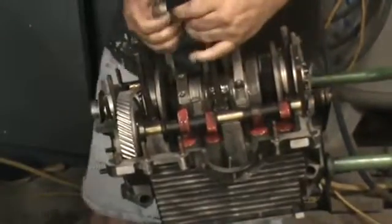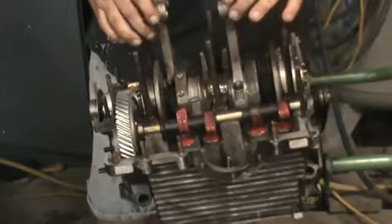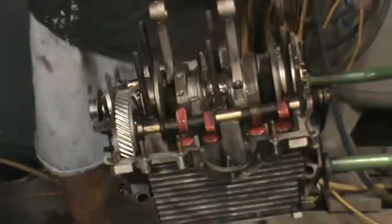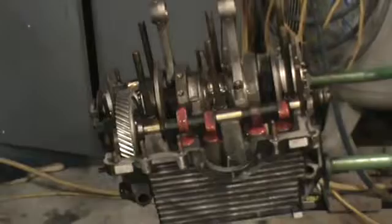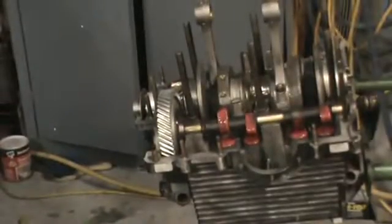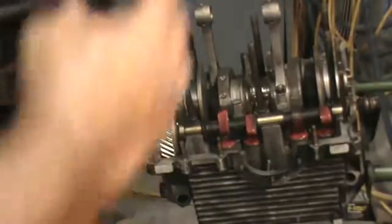We're going to put pressure on our rods again. They can stand up, hopefully. Let me give it one more look. We got our cam plug in, we have our silicone in place. I think we're good to go. Let's lower the case halves and get this bolted together. We have our bearing in here, we have our lifters, we got our double thrust bearing. I think we're good.